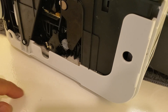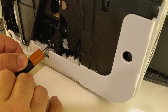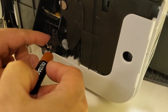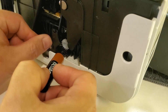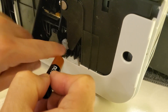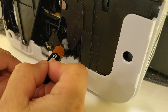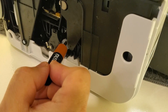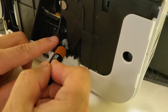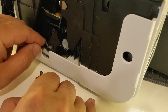Now here are the gears. What happens is that mechanism goes in and out — that axle turns right there on the black gear — but the axle turns and the black gear does not. The black gear is supposed to connect with the white gear and make it turn, and that white gear will turn and allow your carriage return to go in and out. I'm going to attempt to remove the triangular piece here with the gear that spins on its axis — the one that's supposed to turn the white gear.